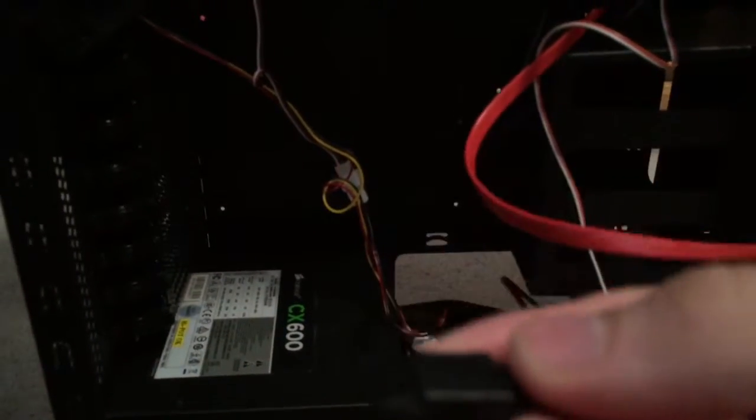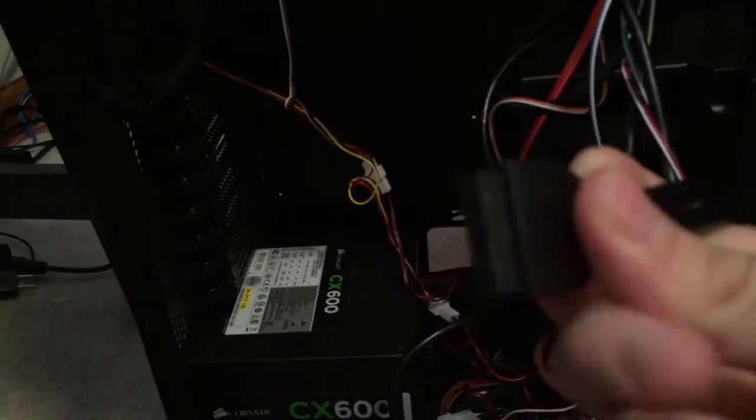But one thing I do like is this. The SATA comes down. You plug this into the motherboard, and there is a reset switch right up here for the motherboard. And then you got the power switch, which all of that comes in with the wires down here. So yeah, you got your USBs right here, all the front USBs. I believe that they might just be for these. Yeah, those are just for these, because your USB 3.0s are actually, where are they at? Buried down in here. This wire. This is my 3.0s right here.